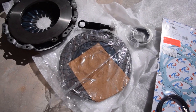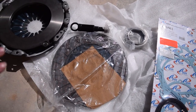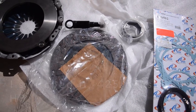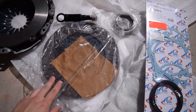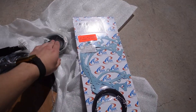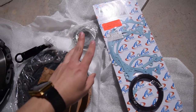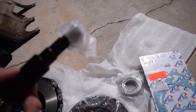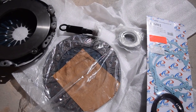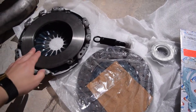Here we have our brand new clutch kit from Concept Z Performance — I'll put a link and part number in the description. This one specifically is rated at 450 foot-pounds of torque and 425 horsepower. This is an organic Kevlar clutch, so it should be very nice to drive. It comes with a brand new throwout bearing — you can upgrade to a Koyo for about an extra $40. It also comes with a clutch alignment tool, a new pilot bearing, and a new pressure plate. We're going to hop under the car and remove the old one — it should just be six bolts along the outside.